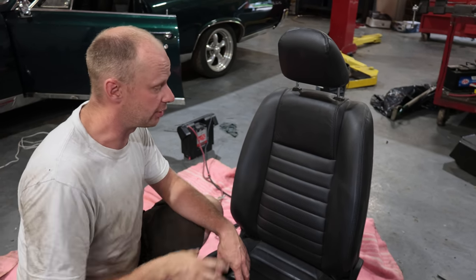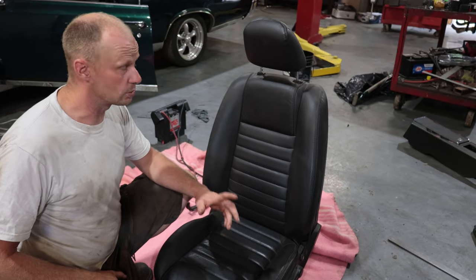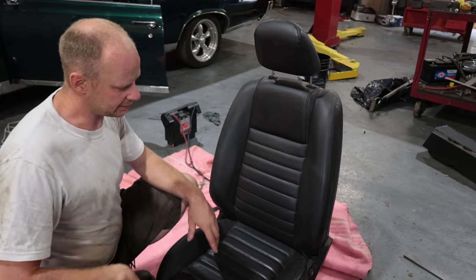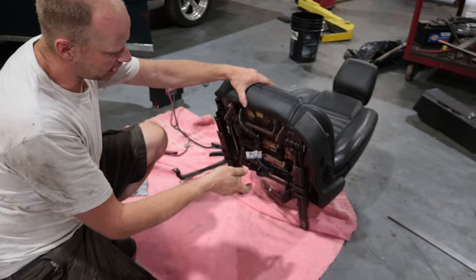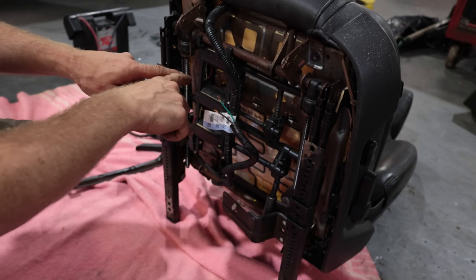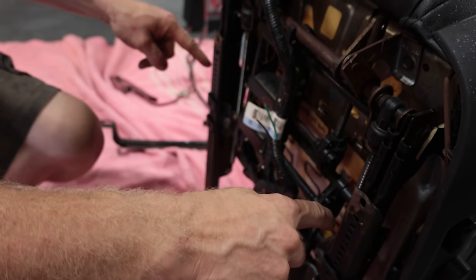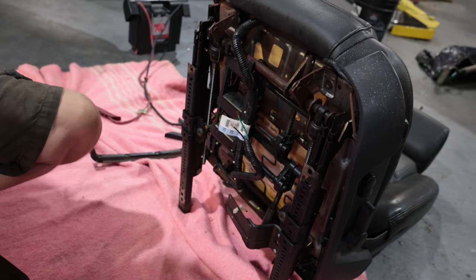We can move the seat even farther back. It was really tiresome driving them in the stock seat. So we sold those. They were leaning to the left and stuff. These are nice and firm. So we're gonna modify the back brackets. I've already cut the forward brackets off. And what I'm gonna do is make a plate that goes across and then comes down and goes into the bolt holes. Take a little bit of screwing around, but very well worth it.